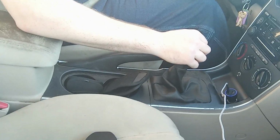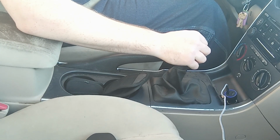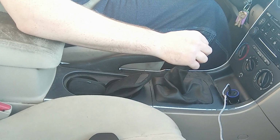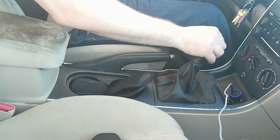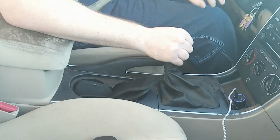That's why it's not just good to know how high your RPMs need to be when you shift, but it's also good to know what speeds or what gears have what speeds, because that way when you're slowing down, if the vehicle's in neutral and you're doing 35 miles an hour, at least in this vehicle, I know that's 4th gear.